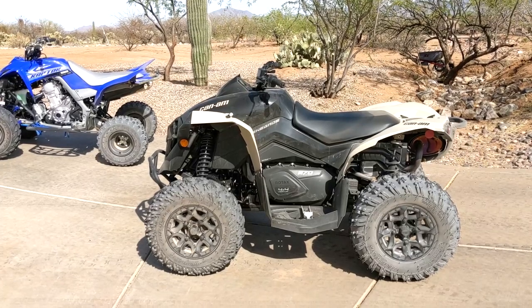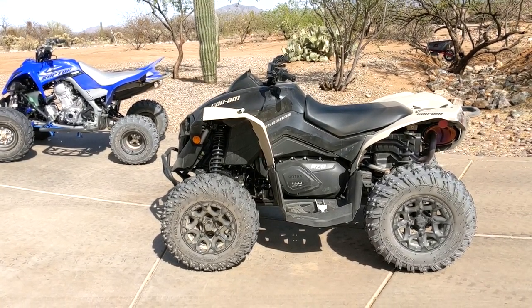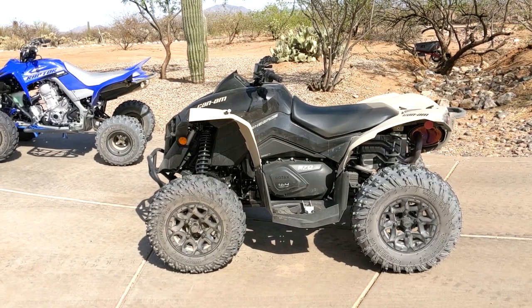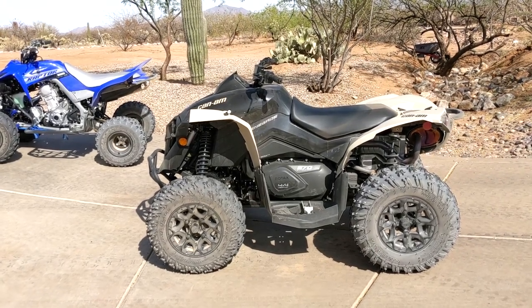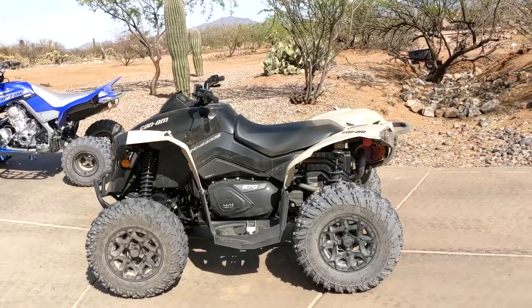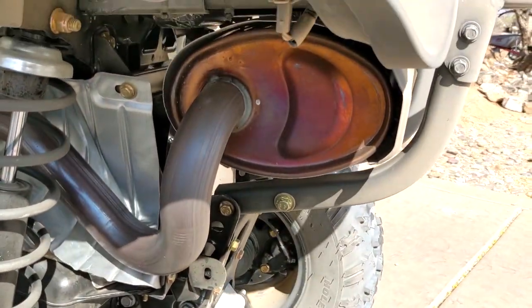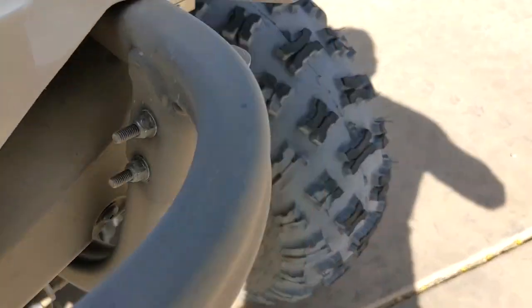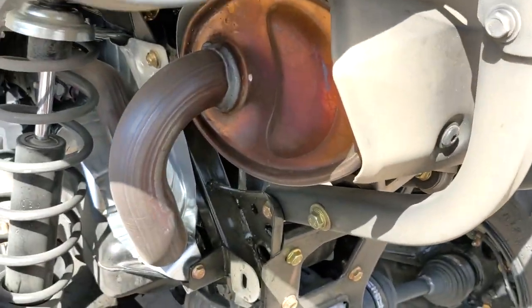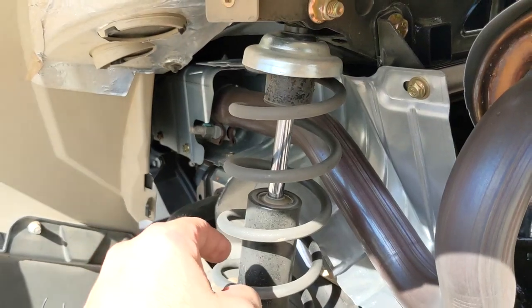What we'll do next is I have a new spring for the primary on the clutch coming — we're going to install that, review it, and I'll show you guys how to install it. It's pretty easy on the primaries on these and it's supposed to help the bottom end tremendously. Then a third stage of mods will probably be a slip-on exhaust. I think the slip-on is really going to help expel some of the heat because the factory muffler is pretty restrictive with a lot of packing and baffling. The exhaust pipe is super tiny too, so a free-flowing muffler should really help. Her biggest remaining complaint of heat is on the left side where the exhaust is, so hopefully the muffler will fix that.